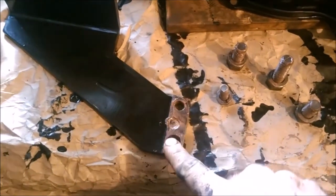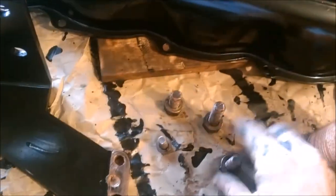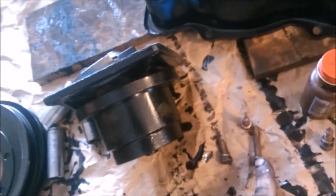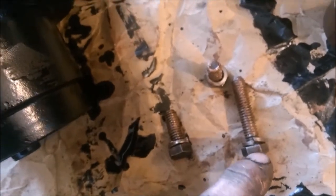Where we'll mount to the engine — if you had any runs, smooth them out. Cover all the threads, even the areas that aren't going to mate, with your copper anti-seize. Backsides of the washers too — all the areas you sanded — that's going to protect everything and keep things from rusting and locking in there. Very thin layer of gasket shellac just on the side of the gasket that goes on the pump impeller area. Copper anti-seize on the nuts and bolts. Use new lock washers — if they're ever flat together when they're apart, replace them. The spring tension is what keeps them from vibrating loose when they're not cranked down.